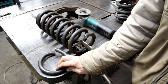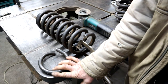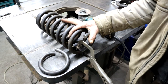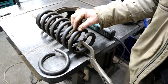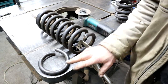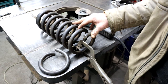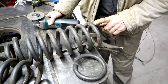So call me a sissy — one coil is out. But you know what, it's so easy to take out these springs. So really, if I feel I want to drop a little bit more, want to see suspension clearances and stuff like that, it's so easy to take out the spring. I'm going to play it safe — I've only cut one coil. Put it back, get all the weight on the truck, and then we see what the stance looks like.